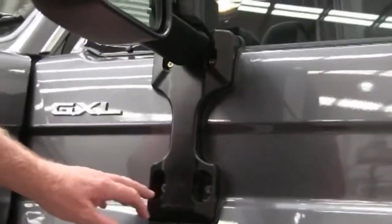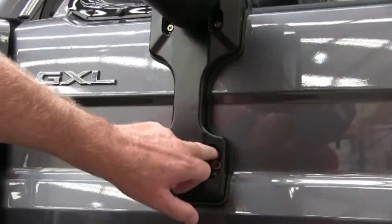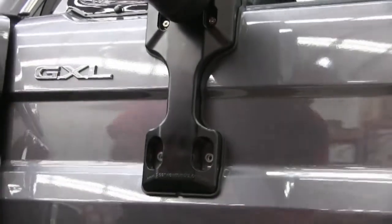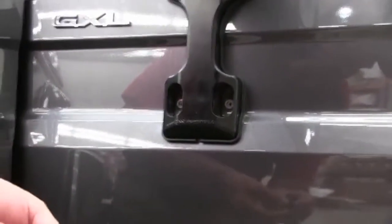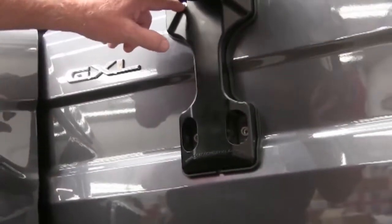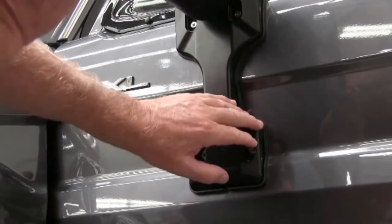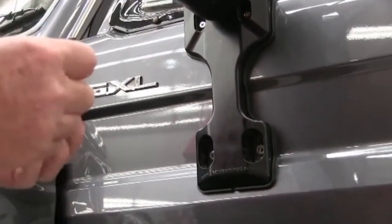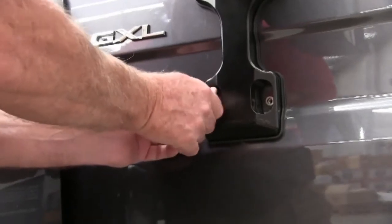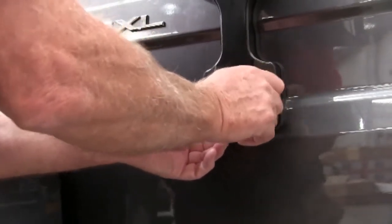One of the first things you'll probably notice is this is the new base, and you can see the position of the holes. You've got a lot of movement if Toyota put the holes up and down because they are all over the place — sometimes they're slightly off to one side. That's why we give you the rotary cup with the slotted hole. If it's got to go sideways in there, so be it, and it will pick its own position up. What you need to do is just put your two top ones in, make sure everything down here is all aligned correctly on the door, and you'll see that it fits like a glove if it's in the right spot. Then you can just put those rotary cups in and get a start on them.